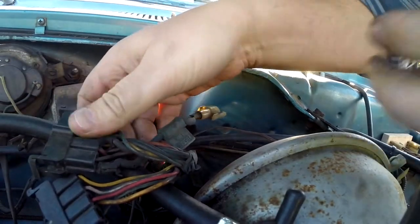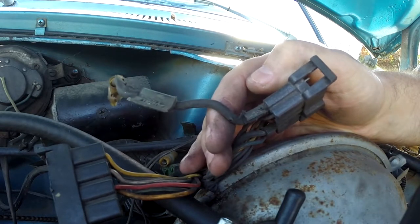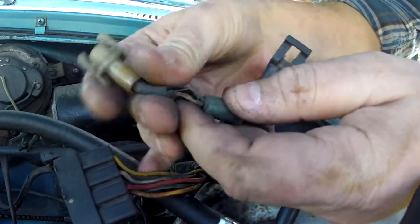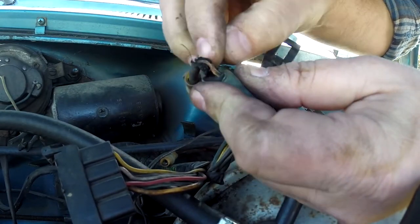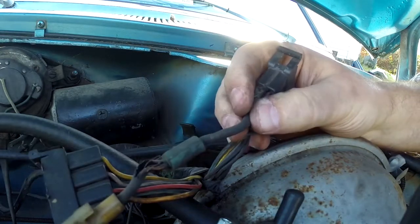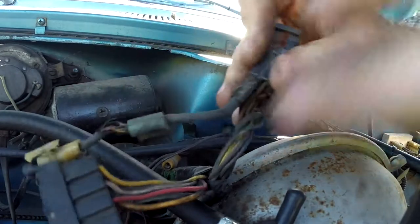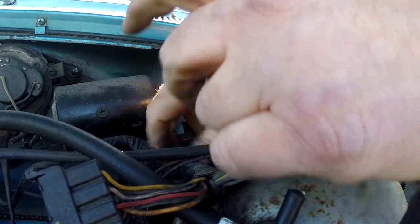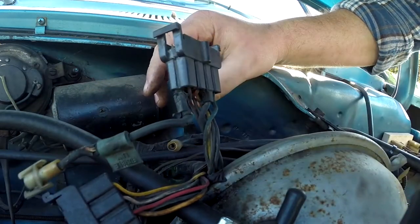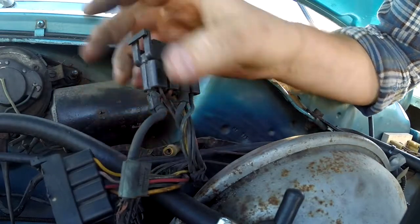Just after doing that last piece — rather than these videos getting too long, I'll do them in little sections. Remember I was saying that it felt broken down here? Well, it is. And after I took off this interconnect, look — it's just burnt. There's still some wire in there, but this is completely fouled up. Fusible link failure — it's kind of what it's supposed to do. It is a protection mechanism. I thought there was a glass fuse in there, but really it's just an interconnect between the wiring harness. I'll probably eliminate that as well. Very definitive, very failed — I like to find the source of things, and that's totally it.